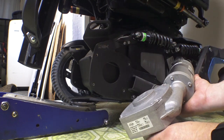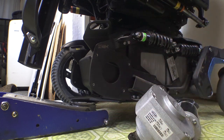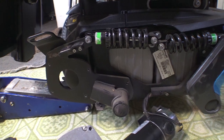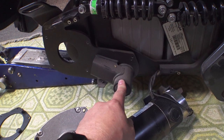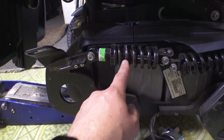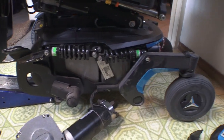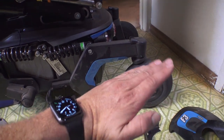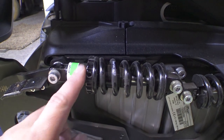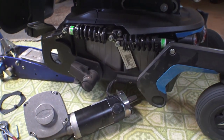There's a little indentation here that sits in a hole, and we've got enough slack to work with. I should probably take some photos — pretty interesting to look at how the suspension works. We've got our main pivot down here, the thing rotates on that, drive tires up here, and then a strut shock absorber spring thing up here. So this whole unit kind of pivots, which explains why the ride is fairly good on these. The rear has a longer cantilever so you get more force on it. I'm actually going to adjust these shocks down even a little bit more. Look how thick the metal is on the frame — I definitely enjoy how heavily built these things are.